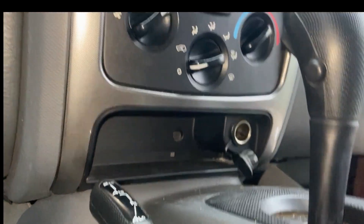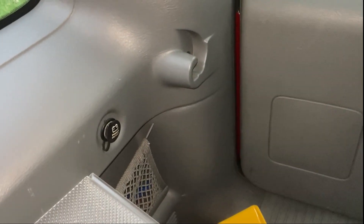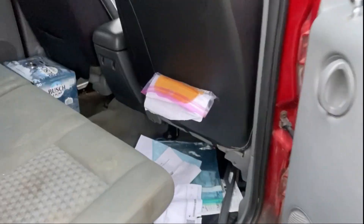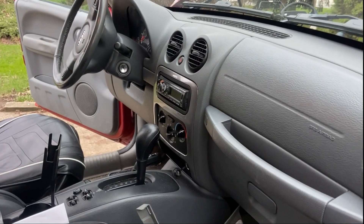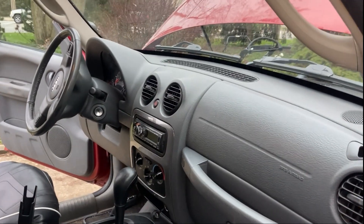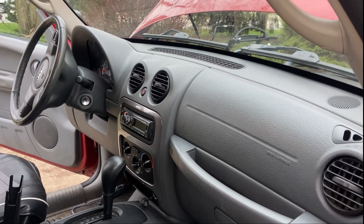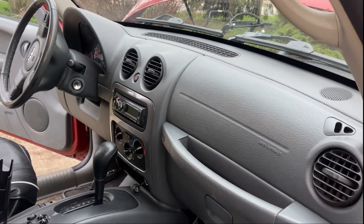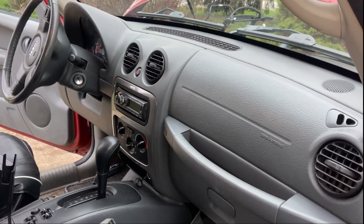This circuit here is 20 amps, and there's one in the trunk of the car as well — there's your second indoor outlet. Harbor Freight sometimes sells 12-volt heaters, so my plan is I can run one or two of those along with this one if I really have to in the future, giving me more heat. One thing you need to be aware of is you don't want to overload your alternator — you'll overheat it, and you don't want to draw too many amps to the point where it can't keep up and charge the battery. This car is supposed to have a 140-amp alternator.